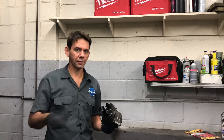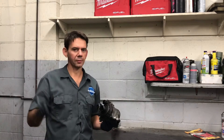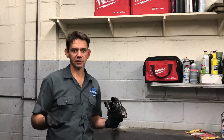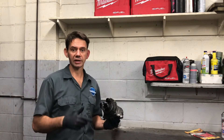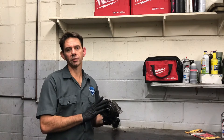On a manual style water pump, when you start the car, the pump is running all the time. Your engine is ice cold and the pump is running. So it takes longer for the car to get up to operating temperatures, which affects the emissions output. Also, when you get into the car and want that heat to come out, you've got that pump pumping the coolant, which is keeping it from heating up as fast as it possibly could.